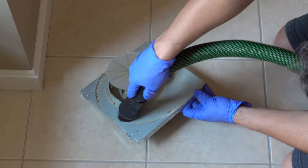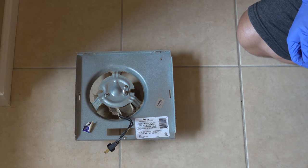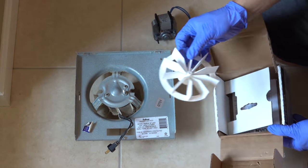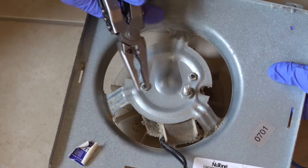With the motor out, now we can replace it. The best part is you can do all this work on your floor, which makes the job a lot simpler. When you order your new motor — if you've already got it then you'll have it in hand, but if not — use that label to get the right one for your fan. Start by removing the old motor from the housing. You just take these two nuts off; you can use a set of pliers or a socket set if you've got one.